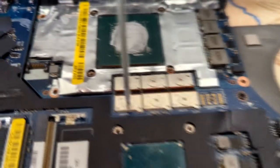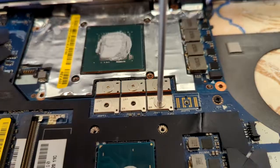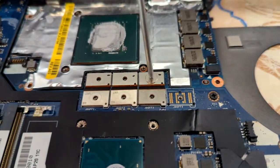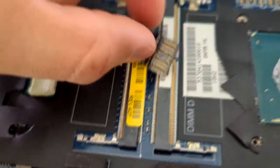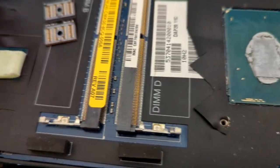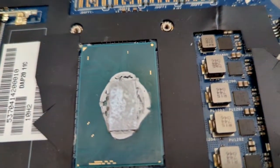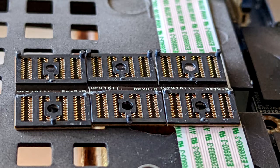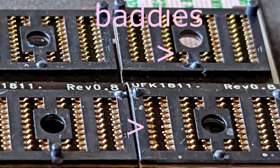I'm a liar — the video I recorded was very bad. So see the teardown on iFixit. Basically, once you get into the machine, remove the three connectors and six Phillips screws — P1 or P0 or P00. They shouldn't be a super tight fit, so don't over-rip it. The connectors come off fairly easily. I took out the graphics card thinking about redoing the thermal paste, but I didn't. I was checking for frame damage — there wasn't any. Luckily, no capacitors came out. Then there's a photo of the connectors, zoomed in where you can see some of the bent pins.